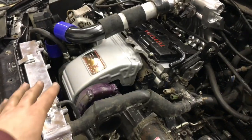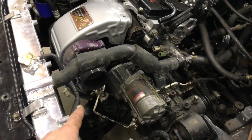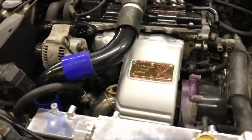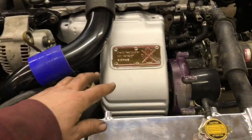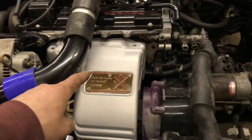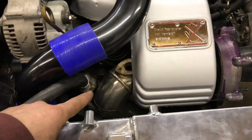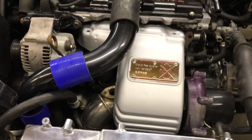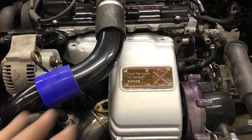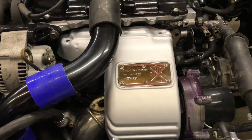Basically what we did: the turbo has been completely installed and clocked to the position we're going to leave it at. I think we got some couplers coming to start hooking it up. We went ahead and installed a factory heat shield with the factory cast iron manifold. Still keeping the three-inch down pipe installed. The tubular manifold looks prettier but we're not really interested in using it — more things crack. This is perfectly fine for what the customer wants. We have a front mount intercooler right there in the factory grille.